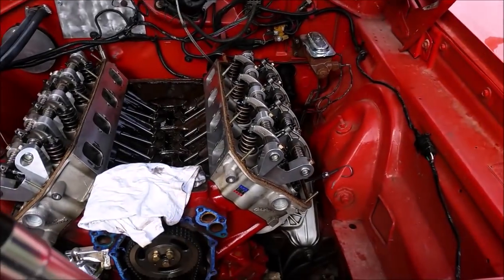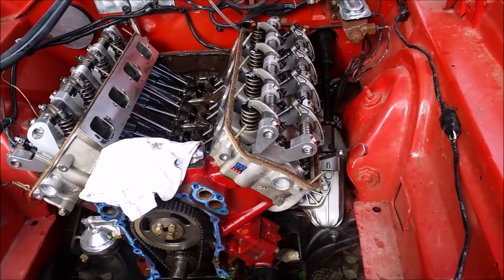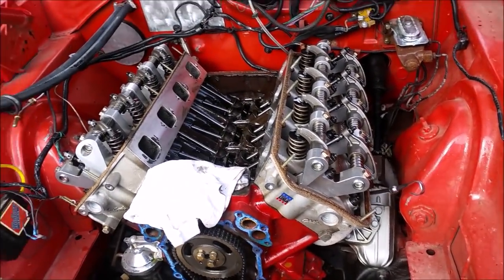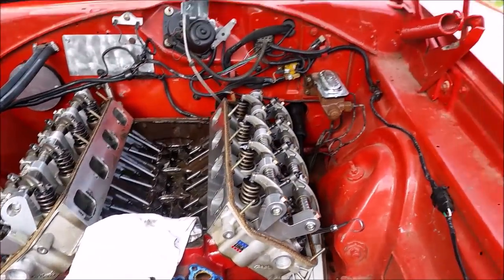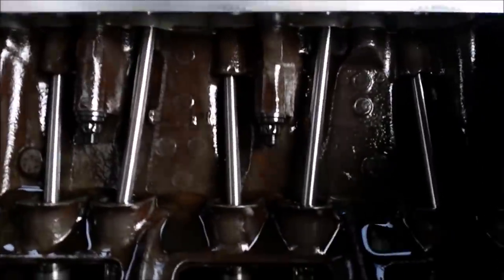You want to re-torque them. Double check all the torque on the head bolts, even though. The ones with the manifolds off. Yeah. We've checked all the ones here on top of the heads, and they were fine previously, the last time the valve covers were off. Yeah, they didn't have any problems. Well, we haven't checked the inner valley studs that hang down. That's one of the parts that's unique to the Hemi, is it has them bolts right there.